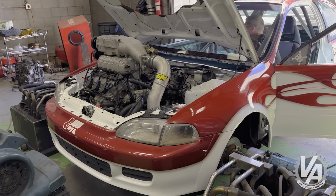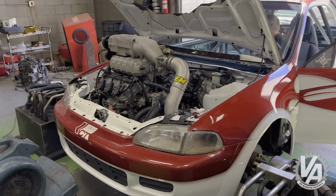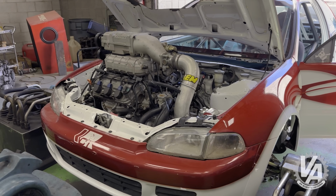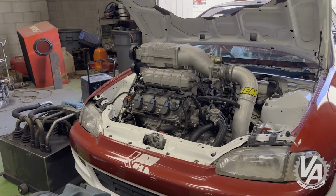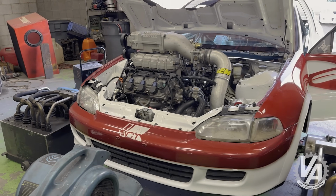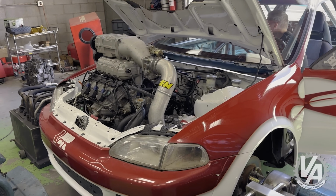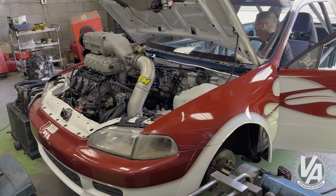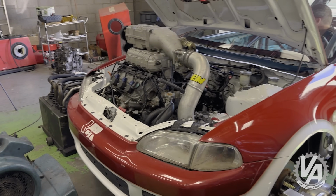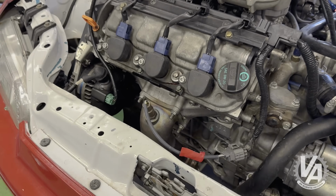It's using the EG J1 mount kit, which mounts the engine for maximum clearance. That way, if we decide to lower the car really low with the slicks on it, it's not going to have a problem. Plus, I'm thinking about street driving it. More on that later. Now, we built this car to test the new swap ECU made by Hondata. Hondata now has a swap ECU for the J series based on the TL ECU. So you need to run the engines that have the single outlet.